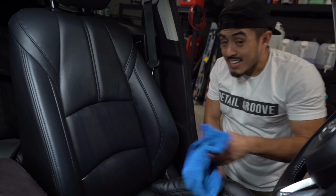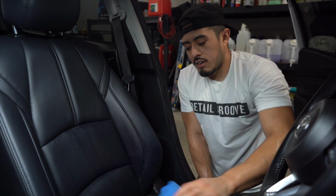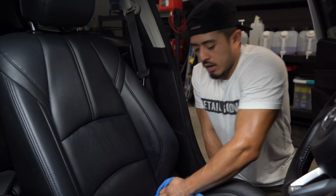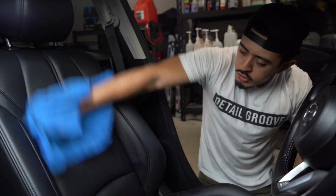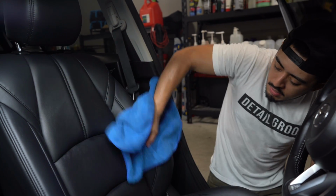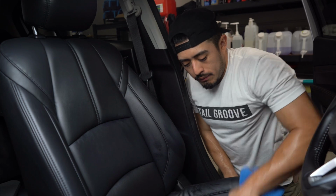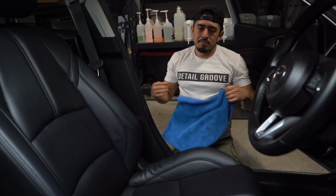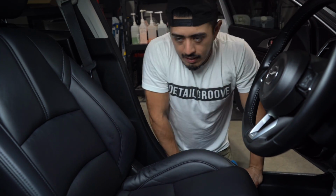Like I'm telling you, it does not take long. I don't care if you're working on some Mercedes, whatever. It's all synthetic leather. They might name it something super cool, but it's gonna be synthetic leather. So you can really just go straight at it. We just use Super Clean, diluted 10-to-1, so you can use whatever all-purpose cleaner that you want. Sure, you can do the debate of like, oh, you should use a dedicated leather cleaner, but mostly all fabric in the interior is synthetic.